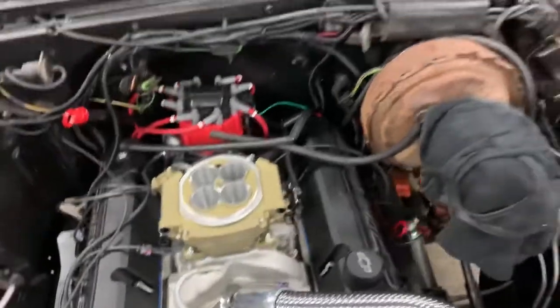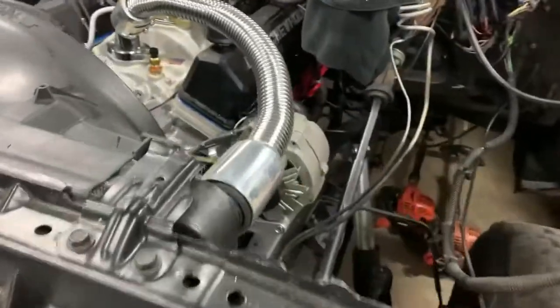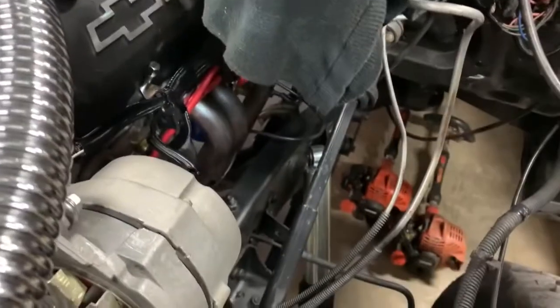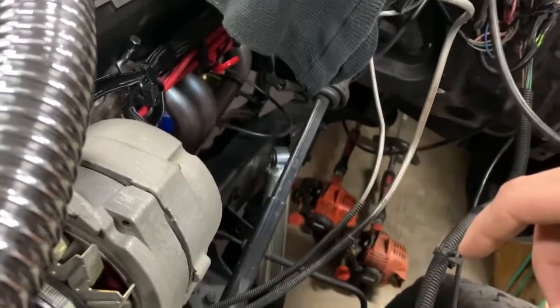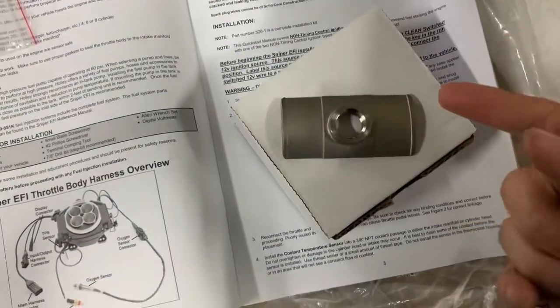And then next up, I have to get on there and figure out, I pretty much decided I'm going to put the O2 sensor, which I'm going to get in there before I run the other wires, but I gotta get my O2 sensor. I'm going to put it in the collector of the header, because it says 1 to 10 inches from where they come together. Well, I can't really put it with a clamp on. Well, I really can't put it on back behind the collector. I could weld it on right behind it and probably be okay, but I can't put the clamps on there. And I don't have big enough clamps. The 3-inch, it takes 3-inch clamps, and no part store, no hardware store, nothing has the clamps to put it on the 3-inch collector. So what I'm going to do is just weld it on the header.